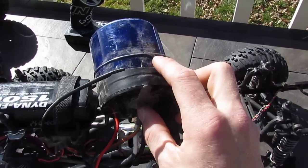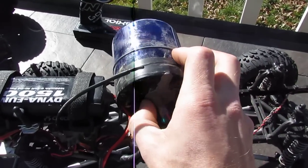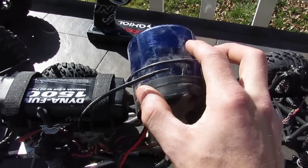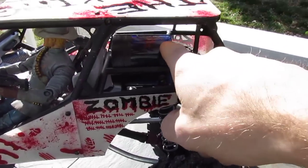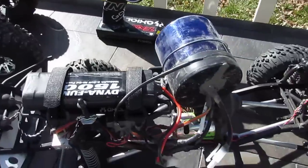The outside jar, you just put it on over the top, marine grease all the threads, and screw it on. Then I went ahead and electrical taped the outside — there's nothing getting in through there. I even went ahead and plasti-dipped this ESC so if condensation builds up in there from running in hot and cold in summer, and water drips on the ESC, it's plasti-dipped. I didn't plasti-dip the ESC in the Trekker, and it's holding up — not a biggie.